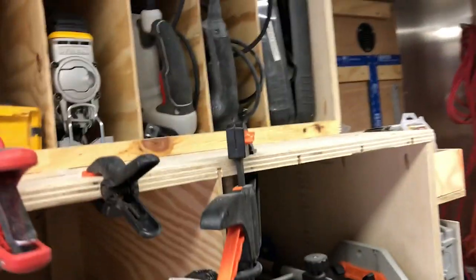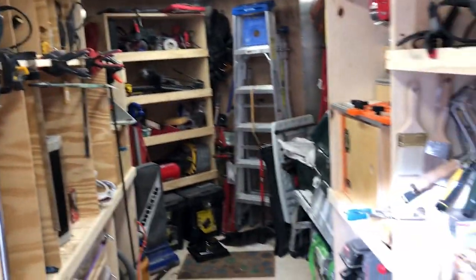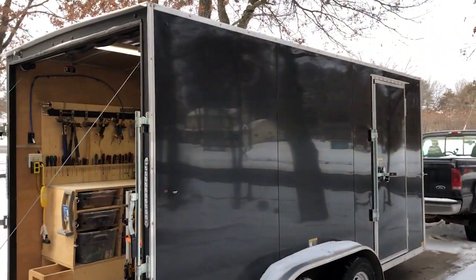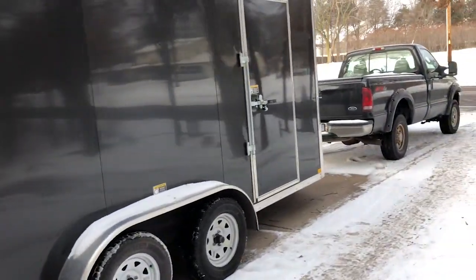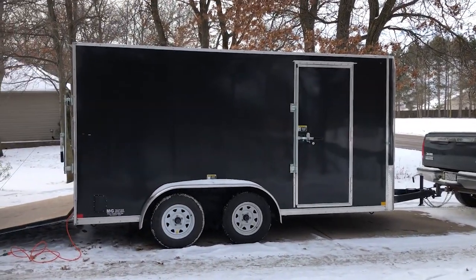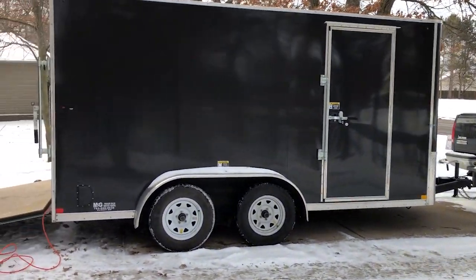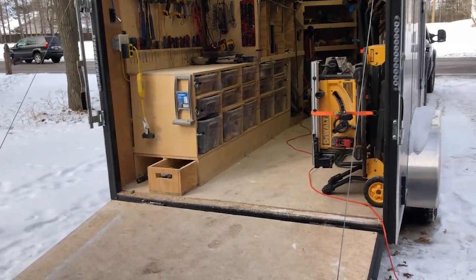Overall I'm super happy with this trailer — I think it works great. I've taken a lot of cues from what Ron Polk has done with his trailers; his new one is really cool, and his old one is kind of what I was working from when I started. This is a 7 by 14, about 6 inches of extra ceiling height so it's 6 foot 6, tandem axle. It's an H&H trailer made out of Iowa — it's been really great, pulls fantastic. I have an F-350 that I pull it with and I get about 16 miles per gallon pulling this. It weighs a little under 5,000 pounds — I had it weighed. The tongue weight is about 15% of the gross, so it's a little heavy, but when I'm pulling long distances I usually have a tile saw and materials loaded fairly far back and it balances out just fine.